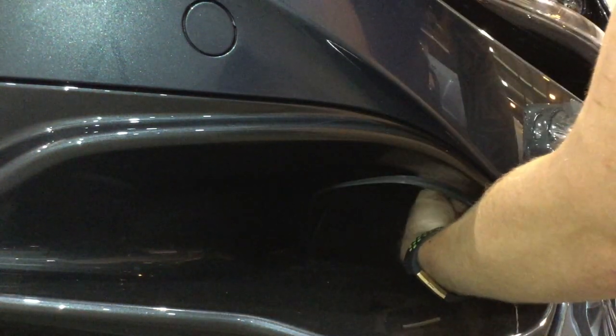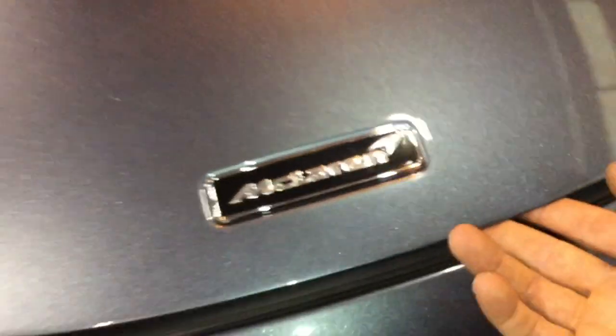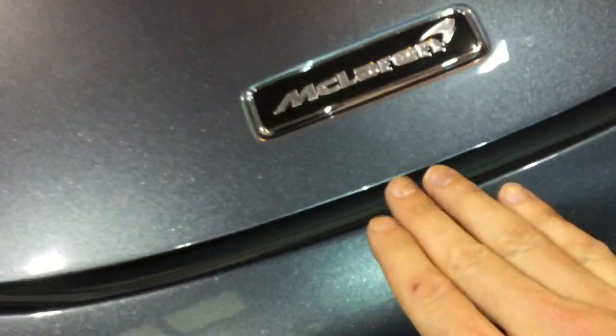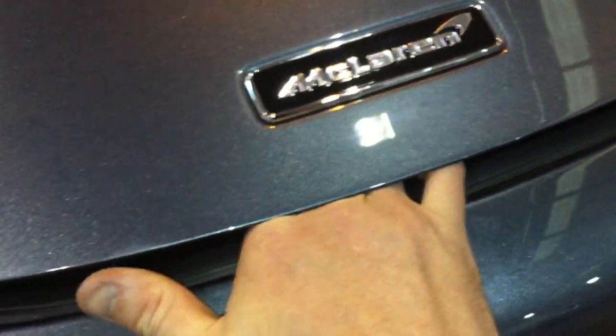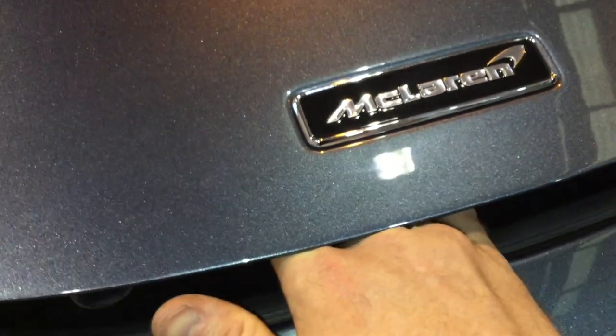The bonnet is now open. Again, remember to retrieve the key. So now the front bonnet luggage bin is popped on the car. You'll find that it won't lift up as it normally would, so what you've got to do is slide your hand up underneath the latch and you'll be able to feel a little lever. Push the lever towards the driver's side and then lift up, and then the bonnet will open.